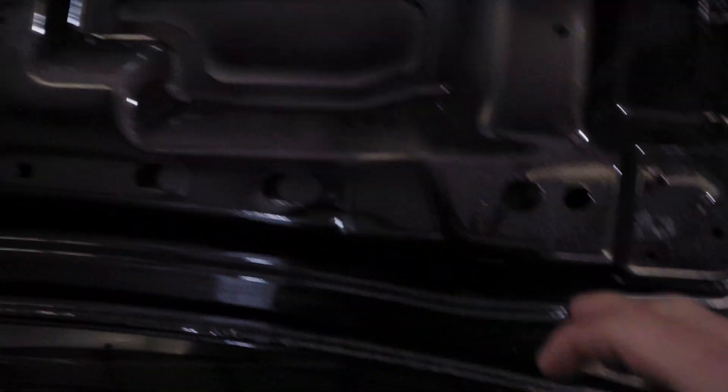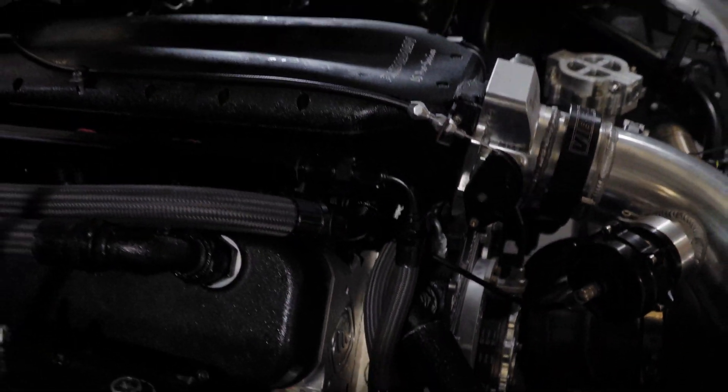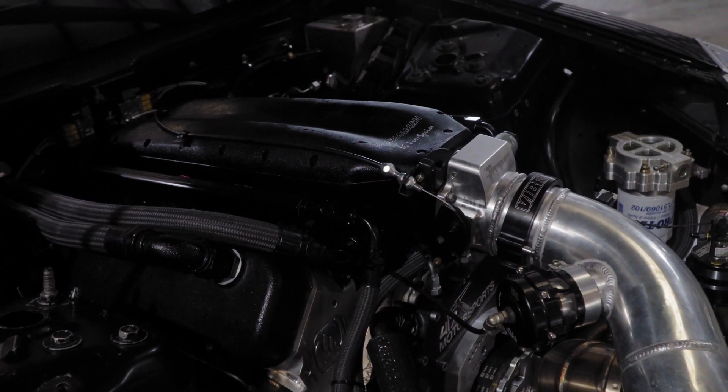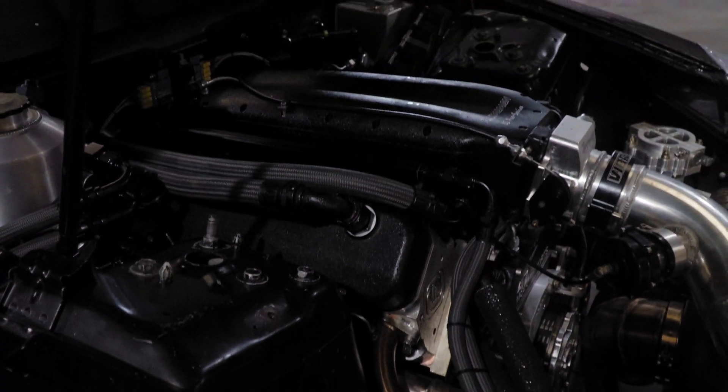Here we go — we got the box. It's not fully welded, it's all tacked together, but it is one solid object. It's going to be mounted here. We've got a two-inch pipe that's going to go up through the hood for the vent. We've got this hose which goes all the way up to the bulkhead where we have some AN fittings, and then on this side AN fittings come through and go to the valve cover vent and to the crankcase. On the next video we'll show it finishing getting welded up, and then we're taking this thing to the track this weekend to have some fun and get some testing done.